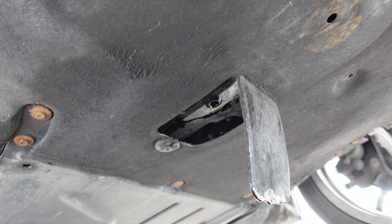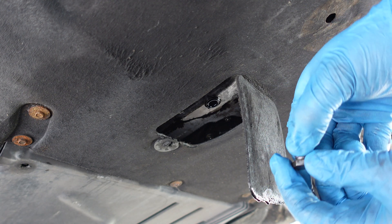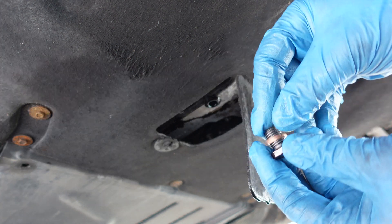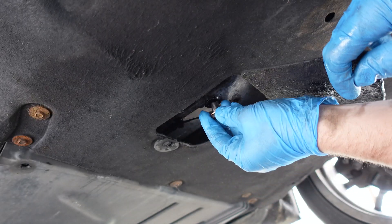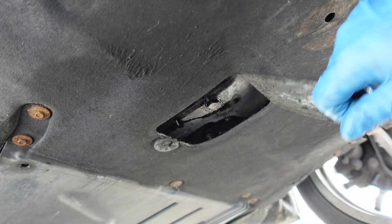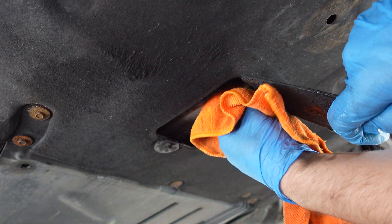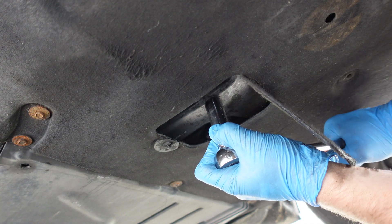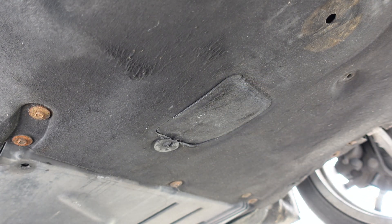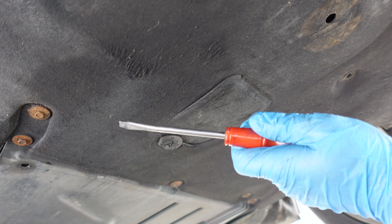Under the car now — this is pretty much finished draining. Take the old washer off, put your new one on and put the sump plug back. This is also torqued to 25 newton metres, but again just do it tight but not too tight. Give that oil around there a bit of a clean up as well. Then you can push this flap back up and use the flathead screwdriver to lock it.